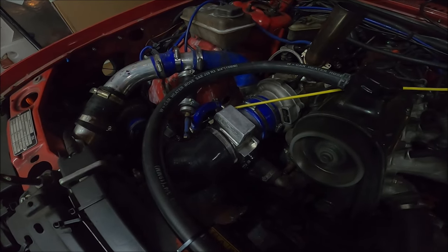This little bit, which I'll insert somewhere in the video, is basically to update on the thing with the AFRs being weird. Although I was 99% sure it was the lambda sensor playing that, there's always that bit of what-if paranoia. So I swapped back the chips one at a time: literally put the fuel chip back in, went for a drive, swapped back to the other one, then put the ignition chip in, went for a drive, and yeah, no change. So it's not the chips. The AFRs are fine.